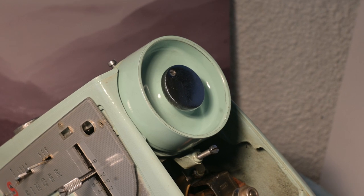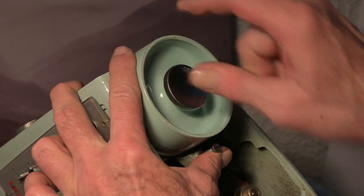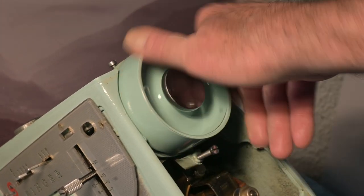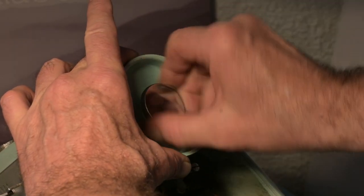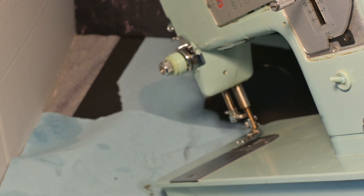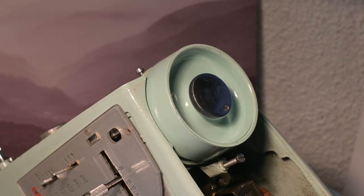It is set correctly now. The lock washer — when I turn it to the right, it engages and allows the sewing machine to sew. When I turn it to the left, it loosens and disengages the horizontal arm shaft and needle bar, and it's just hanging there while I play with the hand wheel. So that is where I'm at now.